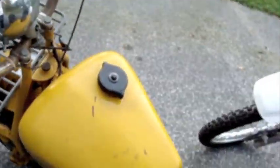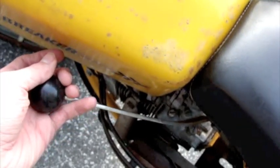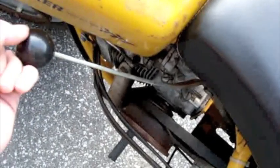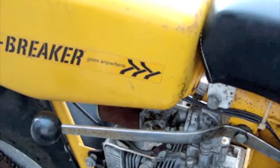This is kind of an unusual bike for sure. The shifter is right here. There's a really low crawling gear that doesn't take you above about 5 miles an hour — you pull that back for low gear. Second gear will take you to about 12 or 15 miles an hour. Then you push it down all the way for third gear, which is the high-speed gear, but the bike will only do about 20 miles an hour fully revved out. So it's not a particularly fast thing.